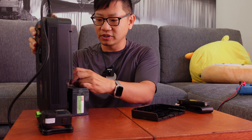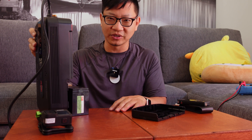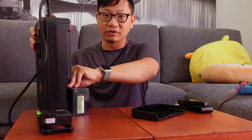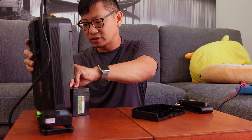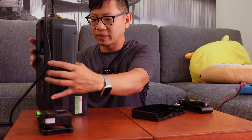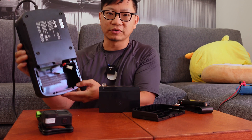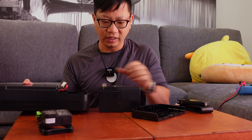There typically isn't too much danger in doing these, particularly because the units are already dead. Obviously you'll want to unplug your UPS unit — never do this with it plugged in. It's just a simple matter of pulling them out. These are blade units and because they're practically dead, there's very low voltage, so there's very low risk of shock — but you do want to be careful. If you have insulating gloves or leather gloves, now would be a good time to put them on. I'm generally very careful, and I know this is a completely dead battery. So I'll slide off the connectors — there's always a risk of electric shock. As you can see, it's just red for positive and black for negative. This is a spent battery.